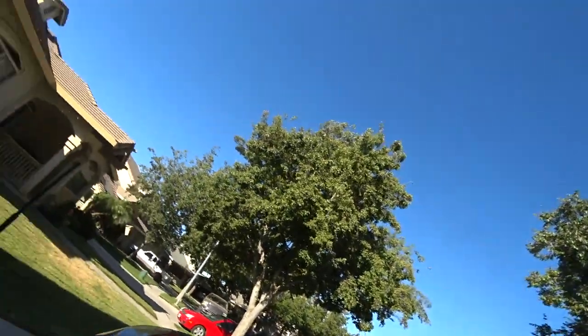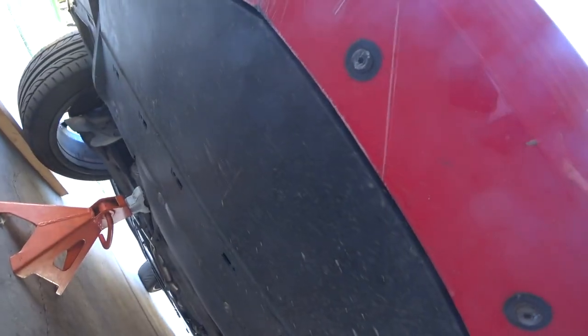And then you're gonna reuse, I wanna say these are T15s. Yeah, my bottom has been scraping a lot. But anyway, these are T15s right here. So you're gonna take all these out, replace it with the front splitter, and then put all these back in the same spot. So, pretty simple job, nothing too crazy.